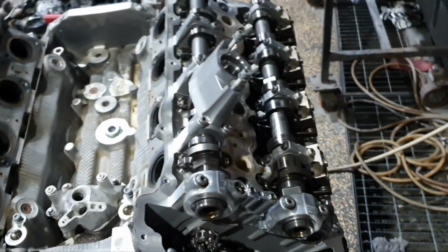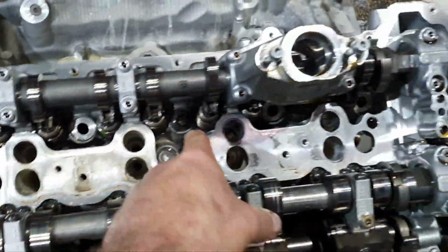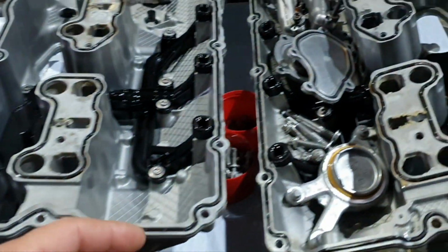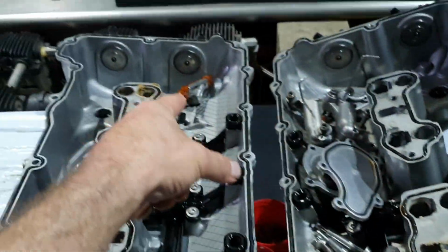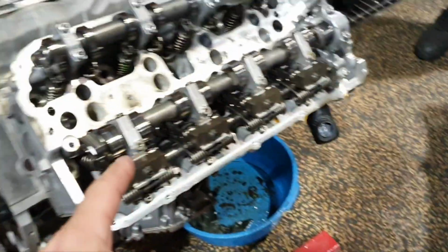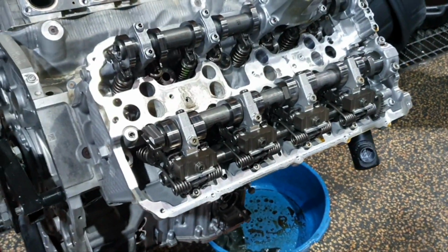Now, I have removed the tensioners, obviously the cam adjusters I showed you earlier, the guide that has the chain from up. I have removed all the bolts, except one in the middle, and the same thing from the other bank. I don't remember which bank has the melted piston. Tensioners, guides, one's there, the other one, where did I put it? It's down over there, and the head bolts are over there. Now, let's take the cylinder heads out to check inside, to see how it looks.